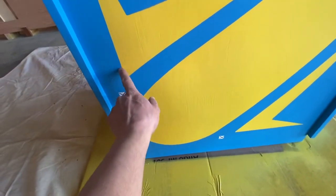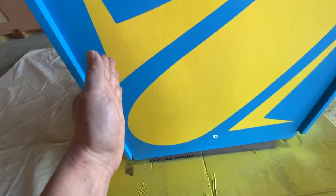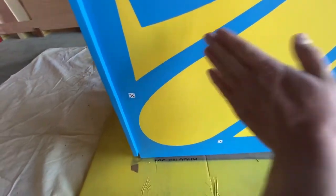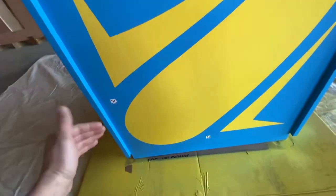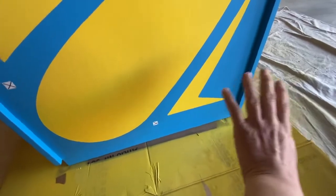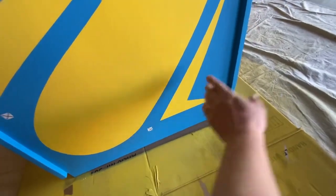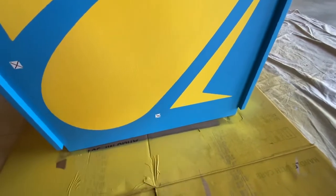When I knew this was lifting — when I was spraying the yellow and silver — I didn't spray into the seam. I actually sprayed from the outside in, trying to make sure I controlled my direction to reduce the dusting, especially down here. I always sprayed at that angle and always kept my nozzle six to eight inches apart.